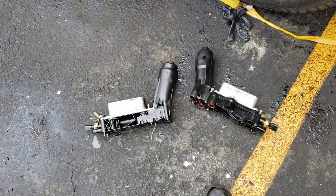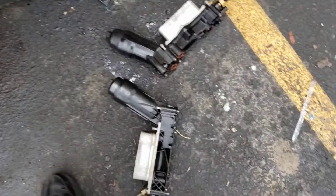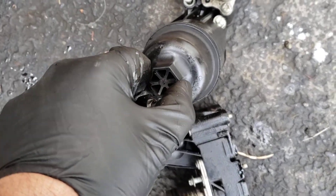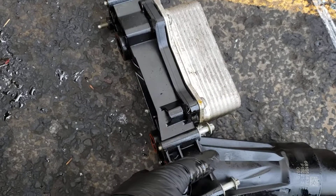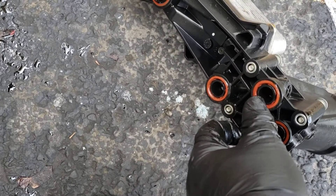The reason why those fail in most cases is over-torquing the oil filter housing. When they over-torque it, this happens — it moves, and then all these seals get busted. That's exactly what happened with those two vehicles.